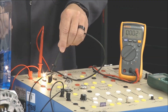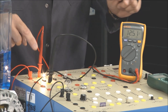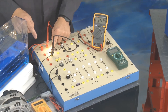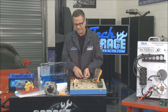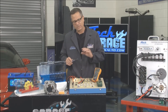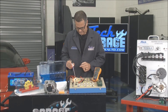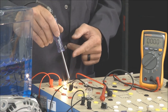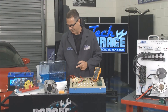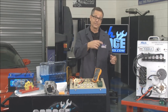On the other graphic, this is voltage drop. If I go across the light bulb and measure from positive to negative, it's dropping 12.51 volts because it has to use all that electricity — the light bulb is an actual load in the circuit. This DVOM is great — I got one here from RockAuto — or you can use a test light. I don't like to use a test light on computer circuits. Over on the ground side, nothing's going through because that light bulb used up the electricity.